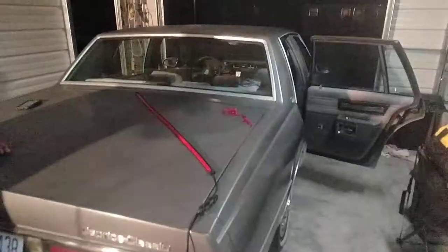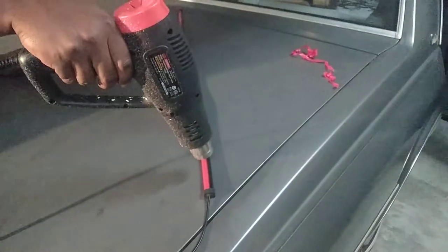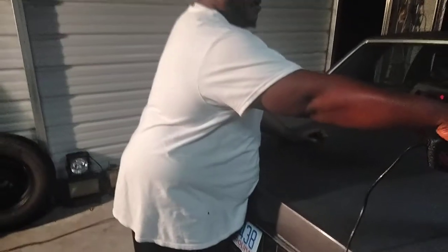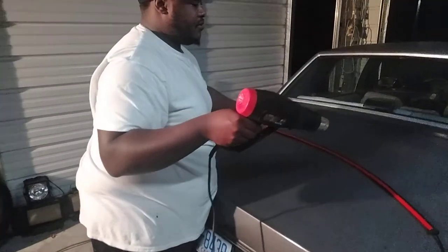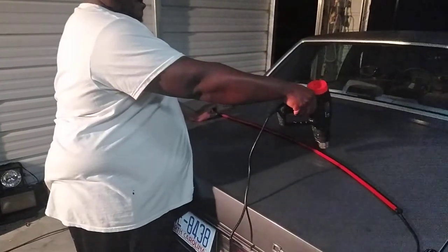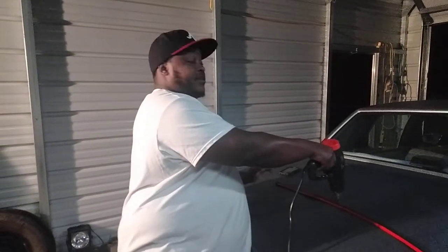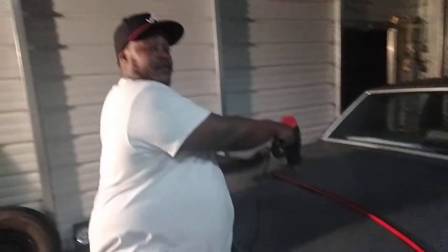All right, y'all back at it. We go ahead and get to step two. I see we got that tape over there. Gotta get your glue up so you go ahead and stick it on up there. And I did a step that I didn't show y'all. It goes on your back rail for your trim panel in the back. What you do is get some 95% alcohol, put it on the rag, and wipe it off. That way you get all the dust and grime, because this is glue. Any dust get on the glue, it won't stick. Just another tip for y'all.